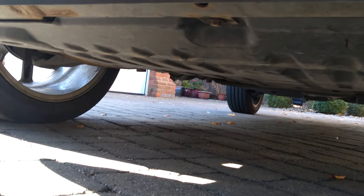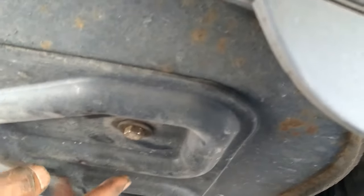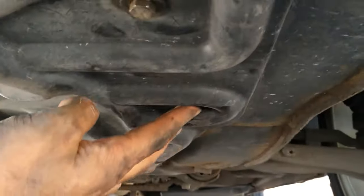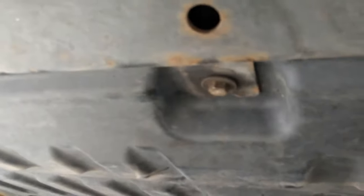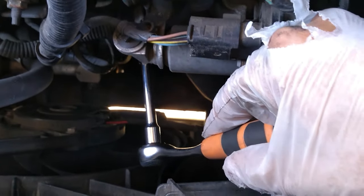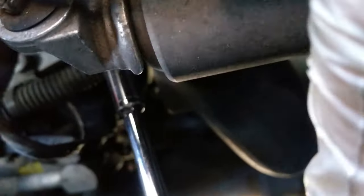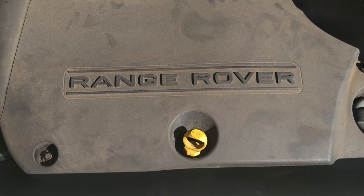I'll show you the under-tray. To push the pipe down through the bottom, you have a few screws — one in the middle, another one, another one, one at the back, and the same on the other side — so about seven screws in total. Very easy to take off. On the top jubilee clip I've actually used a tiny extension on the end of the wrench, which makes it very easy to locate. Remember, coming out of the engine there's a dipstick to the left, the cables, and the socket is directly underneath that. I've now put the cover back on.